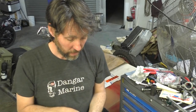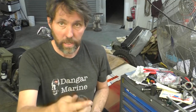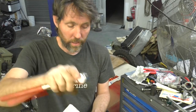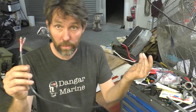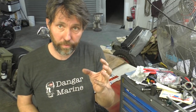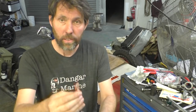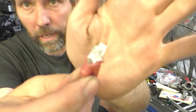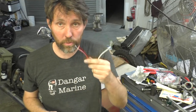This is one of the few actual OEM tools I've got — it's for getting in and holding the nut on the end of the pinion gear for the drive shaft. It comes with a few different size sockets and is spring-loaded, so it just pushes up against it for removing drive shafts. This little loom I made up because a lot of trim tilt units have a round plug — you pull it apart and it's just two female spade connectors inside the plug going down to the trim tilt motor. I made up a little wire with cut-back spade connectors so I can put it into the connector and just supply power straight to the trim tilt motor, which is really good for testing.